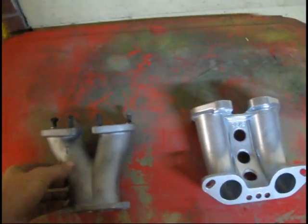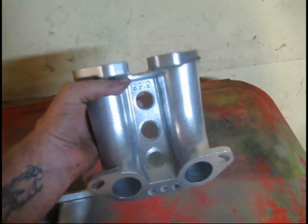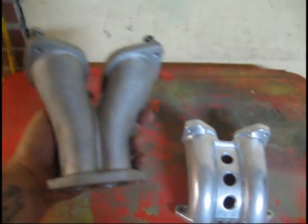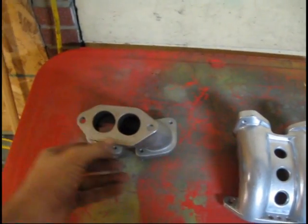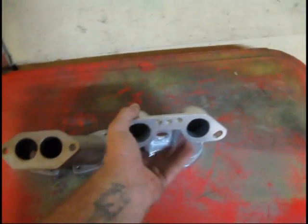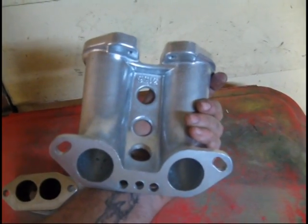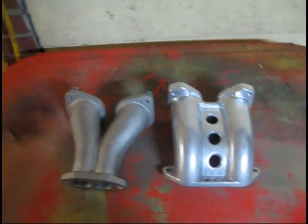Alright guys, I wanted to show you my Christmas present. In order for these carburetors to work on this type four, I had to order a new set of intake manifolds. These are for a type four, and this is part of a set for a type one — you can see the difference. This is where it mounts to the head on the type one; on the type four, this is where it mounts to the head. My dad got me these for Christmas. They came from CB Performance. Love CB Performance — they always have a good product. Just another difference between the type one and the type four engine.